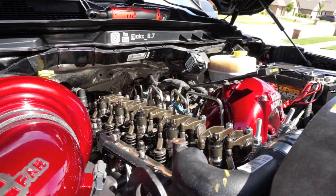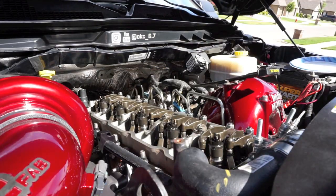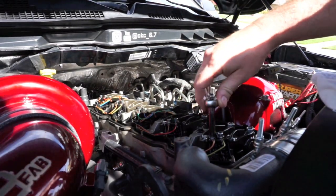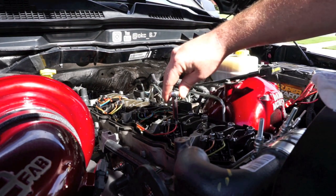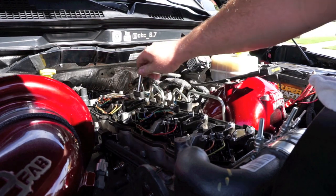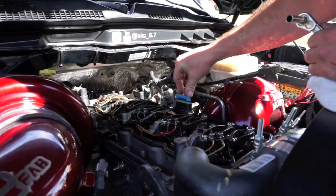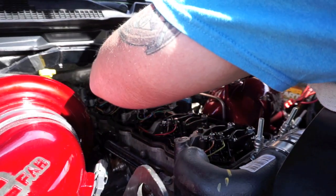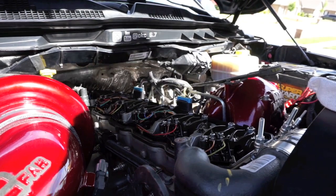All good — just had to make a couple of adjustments. With the rocker box cover on, you go from middle to out and torque it to 18 foot-pounds. Give it a little snug — there's no reason to go crazy tight. If you break one of these injector lugs, you're done for the day and you'll go spend a couple hundred bucks on a new injector. Don't forget to plug your harness back in, and then just the valve cover and we're done.